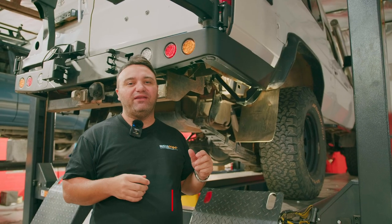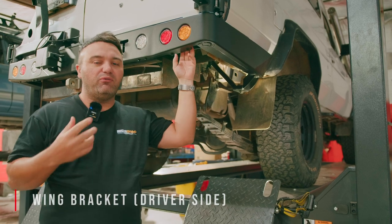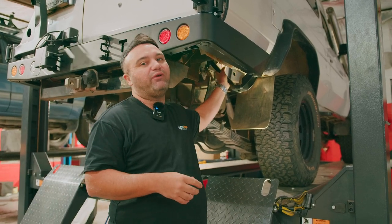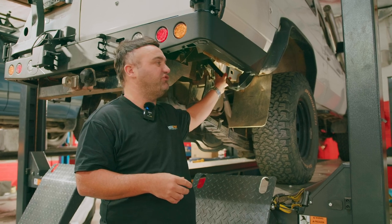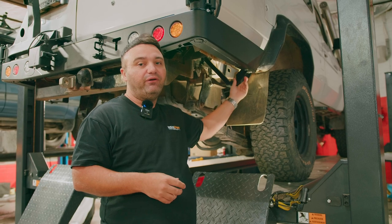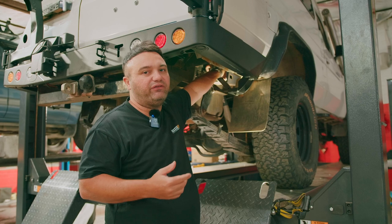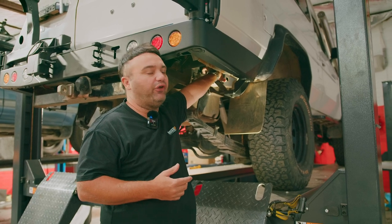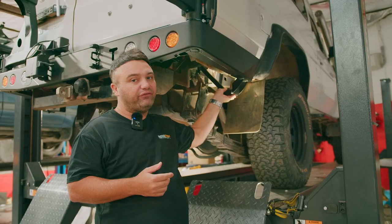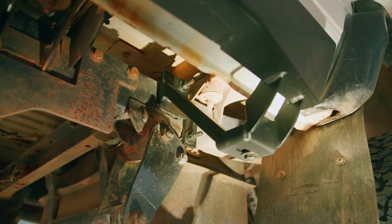Now fitting the bracket on the driver's side of these rear bars on the troop carriers and on the Landcruiser wagon is a little bit more of a simple process — there's no drilling required. You're going to get supplied an angled bracket. The angled bracket just simply bolts onto the lower wing support from the rear bar itself, and then it lines up to pre-existing chassis points on the vehicle. So you'd just be bolting it onto the lower bracket first and then lining it up to the existing holes on the chassis.